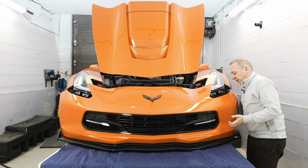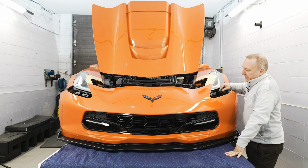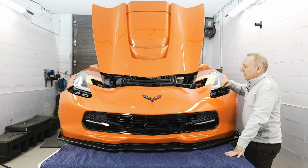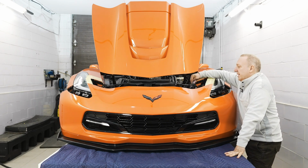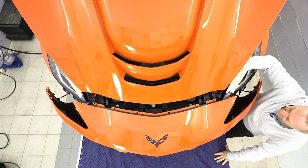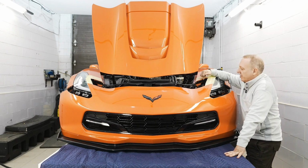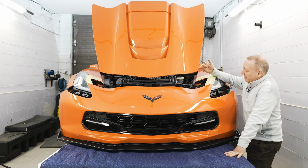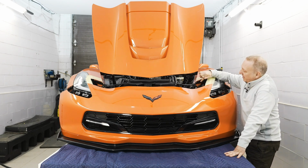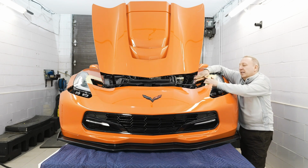Now the reinstallation has a couple of things to pay attention to. We did modify the ductwork, so that's obviously something we're going to keep a lookout for. We're going to be riding on top of the radiator rail here to basically snap these in. And these are the infamous clips or mounting tabs that we were dreading at the beginning of the install. We can now see how they work. You have the 2 square tabs on the bumper. You have 2 7mm screws here. And that basically creates the tightness between the bumper itself and the fender.